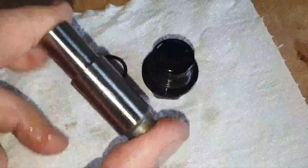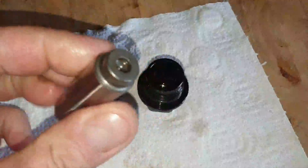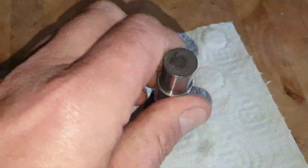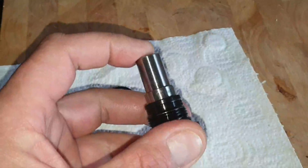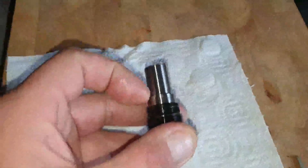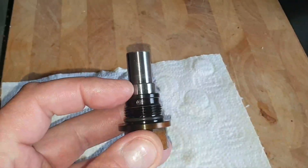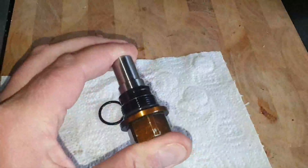The second piece is this top plunger — it's spring-loaded, so this piece sits inside the bucket and the oil builds up behind it and pushes it out. Basically it's spring-loaded, and this piece can't move because it's against the cam chain guide, which normally has one end with a pin through it so it's pivoted. This pushes on it to tension up the chain and take the slack out. So it looks like when the oil pressure builds up, this piston gets pushed out, but if it isn't going anywhere it puts more and more load into the spring.